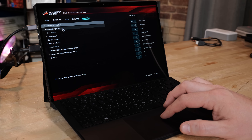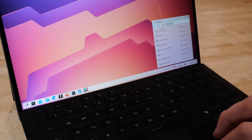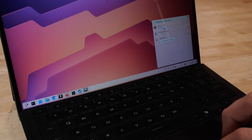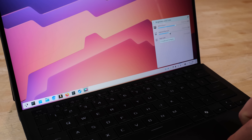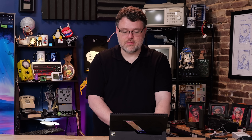Other than the MediaTek Wi-Fi, what else isn't quite there? The fan profile button on the keyboard can work, but you have to install a special USB HID driver that wasn't included automatically as of kernel 6.14.3 — though that's coming and may fix itself with a software update. The keyboard backlight also works under Linux, but Ubuntu incorrectly maps the toggle as a brightness up/down control instead, which seems like a bug. About 90% of the keyboard shortcut functionality works correctly: brightness, touchpad toggle, and so on.